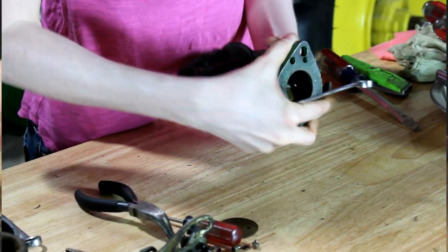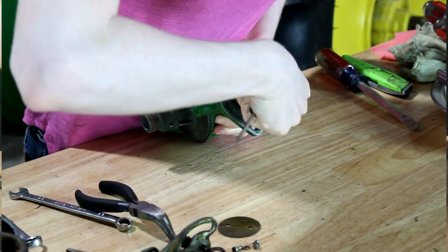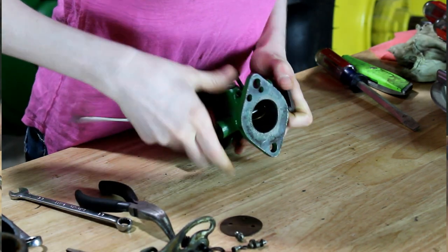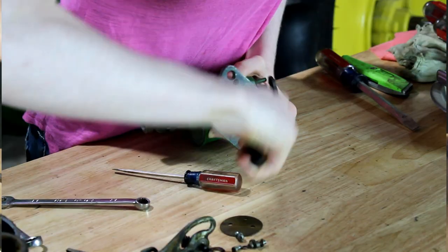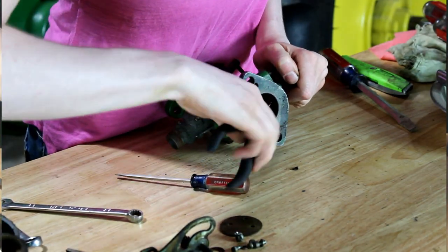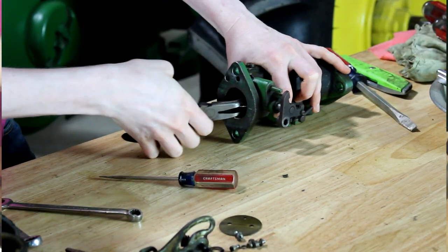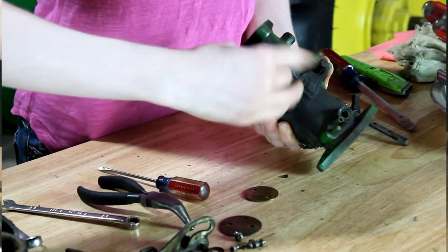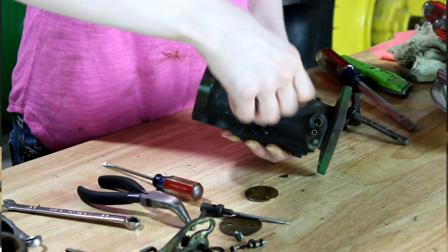Move all these parts aside, flip over to the throttle side, and follow those same similar steps. Turn this throttle door towards us and remove both of those screws. These do have a small little washer behind them. Then turn it up and with a pair of pliers, pull that right out. Up here your high and low needles can come right out — just unscrew them. These are probably the easiest screws on the whole carburetor to move.